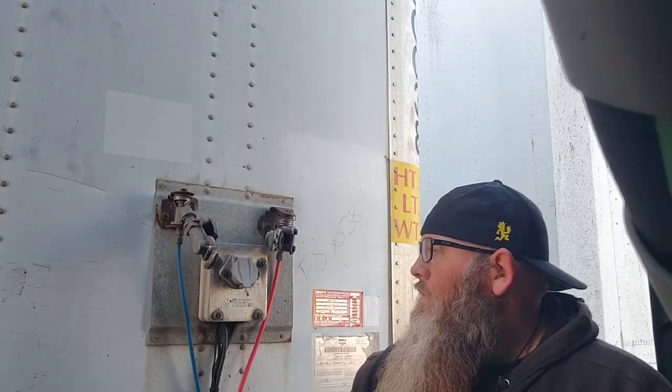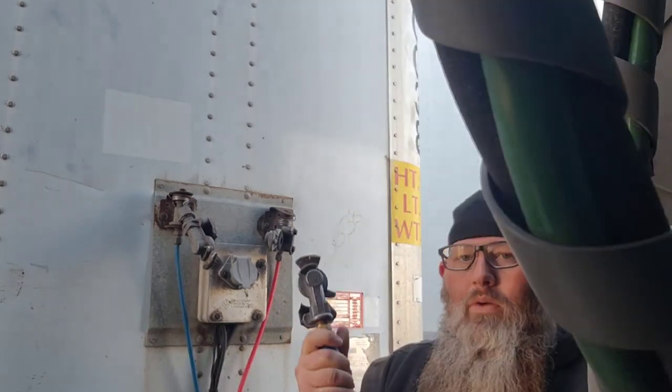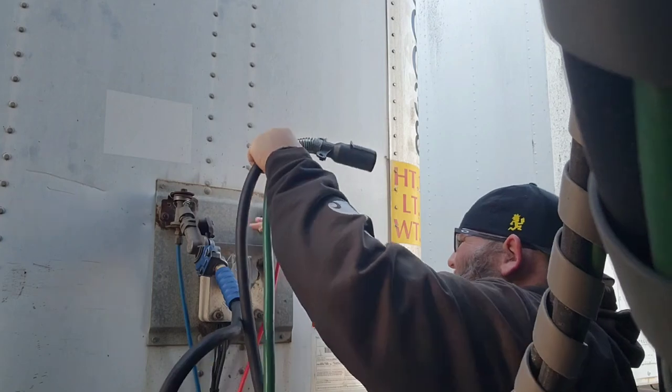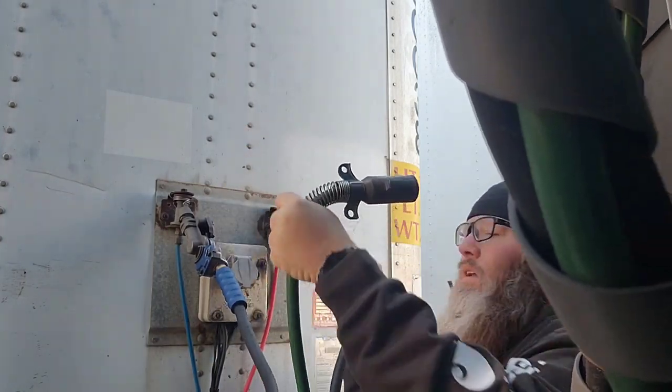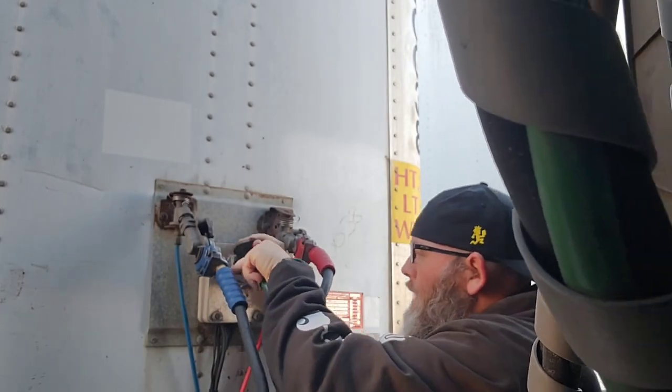Since it's not the nicest trailer ever, when you're hooking this up, the service lines - usually the inside one - they mark it some way with a blue line. Blue to blue. You want to keep your lines matched up correctly - if not they're gonna fight each other.